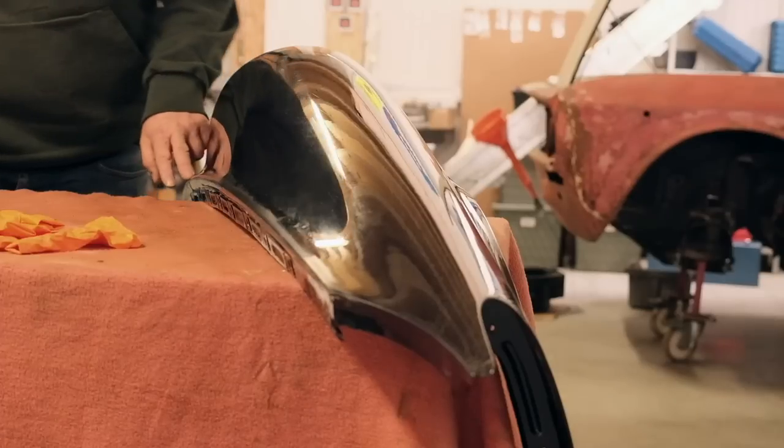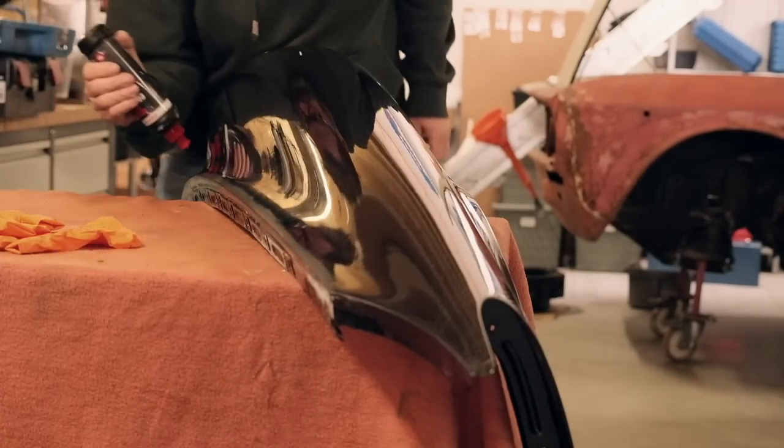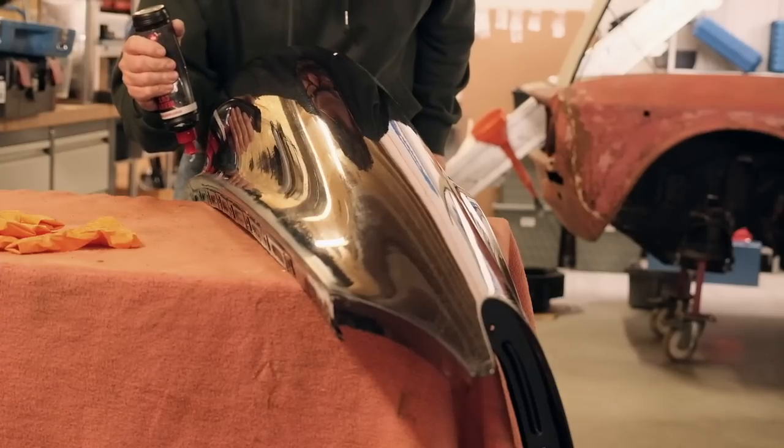The soft edge between old and new clear coat needs to be sanded down in a way that all greater unevenness is leveled out, and then gloss is reinstalled with the polishing wheel.